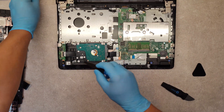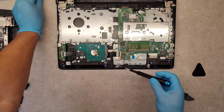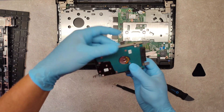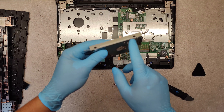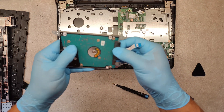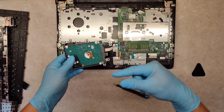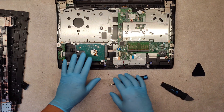For this PC, I will replace the old SATA drive with a new SSD drive. Take out this cable. How to replace the hard drive? Just unscrew the four side screws of the hard drive, place the new one, and connect the SATA connector to the new drive. Then in reverse order, put everything back together.